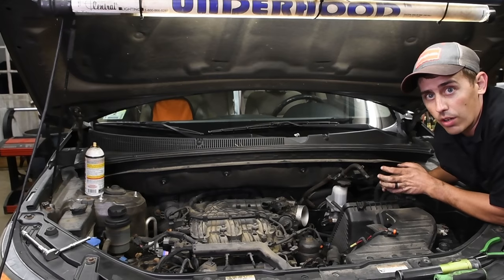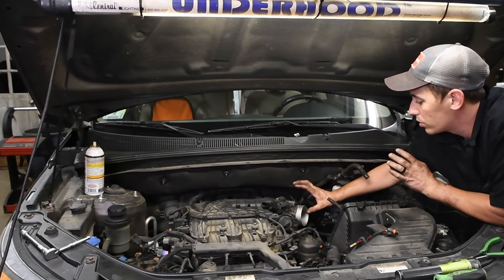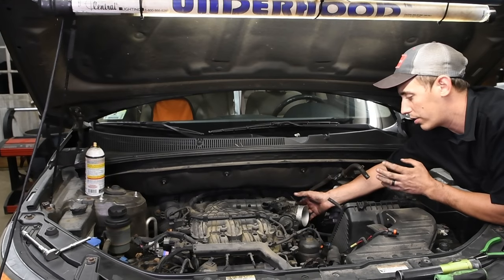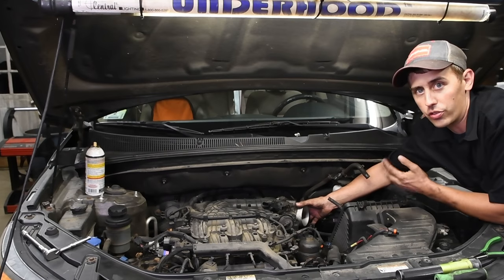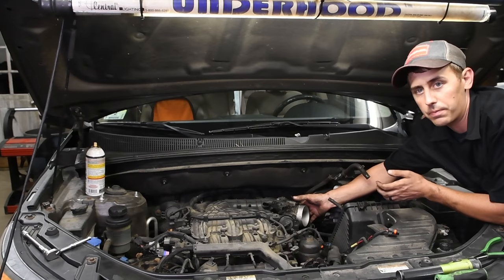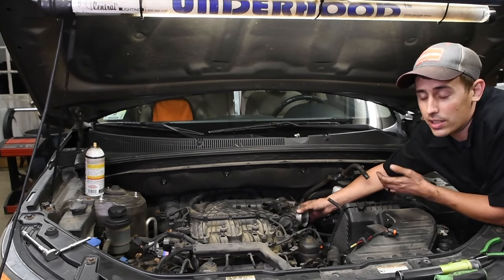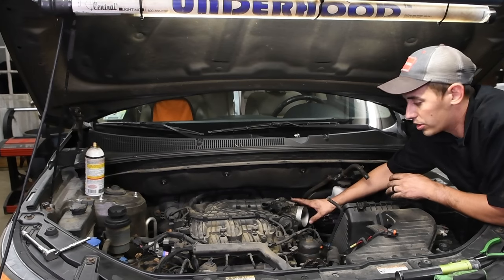Once all those hoses are off, the next step is going to be the throttle body. So I personally like to take the throttle body off of the plenum and leave it in the vehicle. The reason being is there's coolant going through the throttle body. So the options are either drain the cooling system, then take the plenum off with the throttle body attached to it; disconnect the lines without draining the cooling system, but you've got to do it really quick or you're going to make a mess. Either way, it's still going to make a little bit of a mess; or just unbolt the throttle body